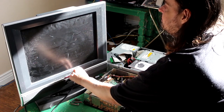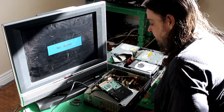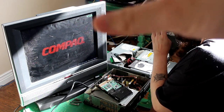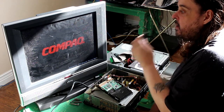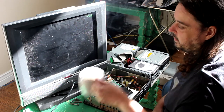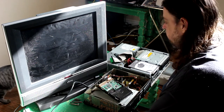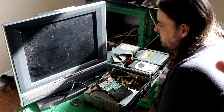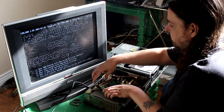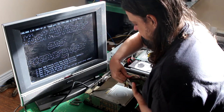Okay, so that was entirely my mistake. I did it too soon. I jumped ahead, which could happen. I did it the first time too when I started modding Xboxes. Oh, did you? Yes, that's a regular mistake. So once you boot up past your computer, because what happens, not all computers, but Compaq specifically, the BIOS on the computer locks whatever drive is hooked up to it before it boots up. But doing it this way, that Linux disk that he's using is basically taking over your computer's BIOS. There we go. Now I swap the drive quickly before this decides to proceed past that screen.